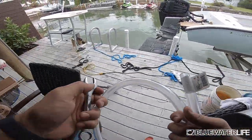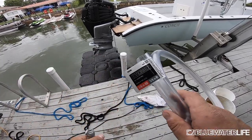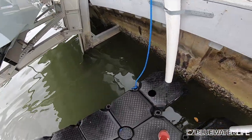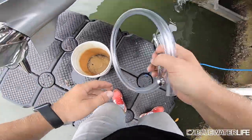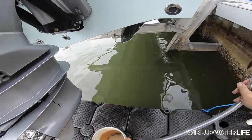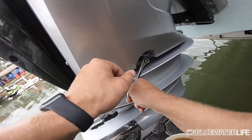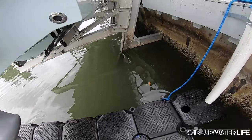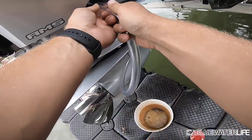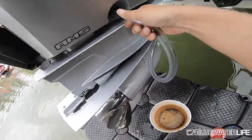To drain the oil, you're going to need a 5/8-inch socket as well as a 5/8 interior diameter hose, which you're going to attach to the bottom of the engine on that bolt. Make sure you have your bucket under you and you're prepared and ready to go. I like to loosen up that drain plug on the side of the engine just a bit so you can get the tube on, then use the tube to screw off the drain plug just enough to get the oil to start to dump.